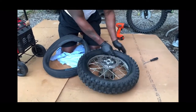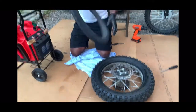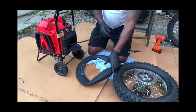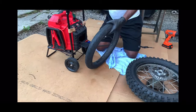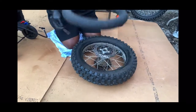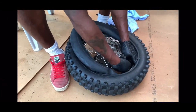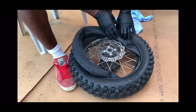Don't tighten it all the way — just leave a little bit of a gap on it. First, what I like to do is put a little bit of air inside the tube before I put the tube inside. I'm gonna do that right now — maybe this is a little too much air, so I'll let some out. You want to make sure you catch the valve stem. As soon as I catch the valve stem, I thread the nut on it a little bit — there you go.